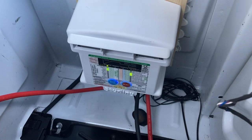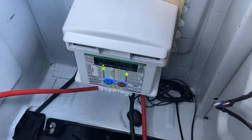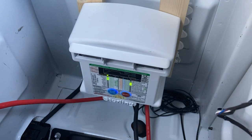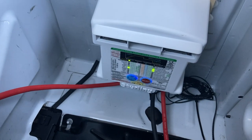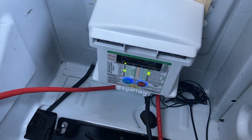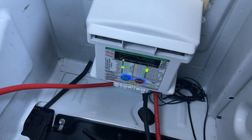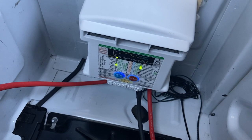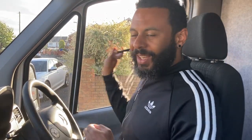It's saying no faults on the right, so that's good. It's on AGM two, which is the selected battery type — we need to double-check that's ours. It's showing 13.8 volts input voltage. We should probably drive it — let's take it for a spin for about five or ten minutes, then stop and see what it's doing.